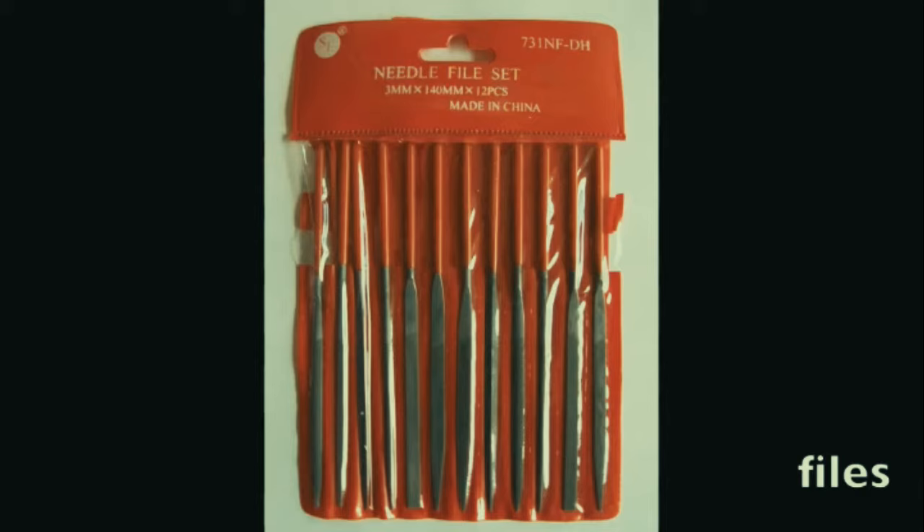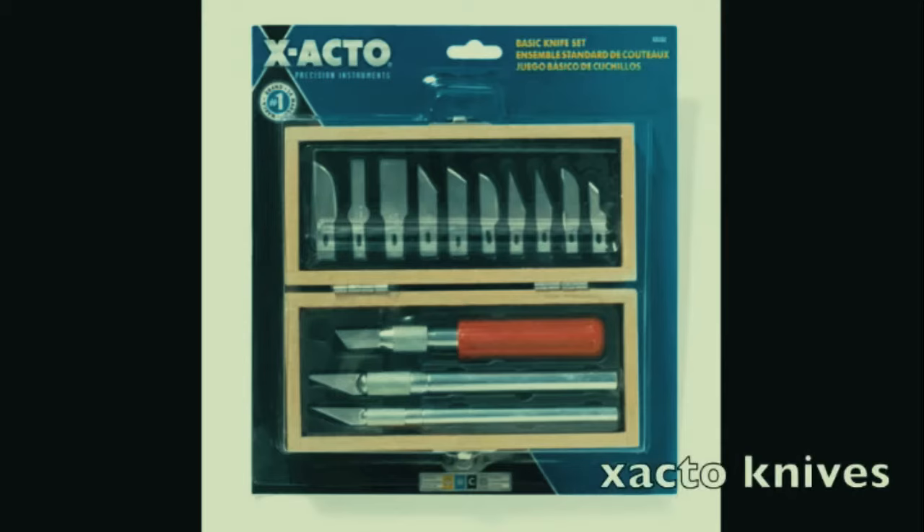Files - definitely get a small set of tiny files. I use these especially for scuffing up a wire or creating contact points on a motherboard. These are actually miniature files, pretty small. Exacto knives are something I use fairly frequently - you never know when you need something really sharp to cut something. They're small and sharp, perfect for getting in there to cut or shave things.